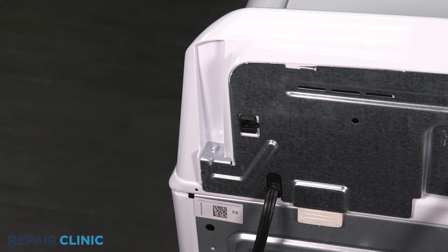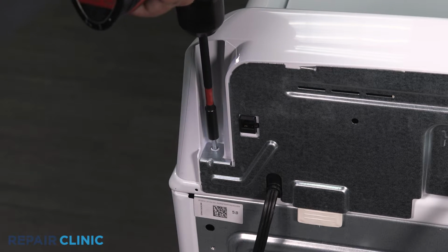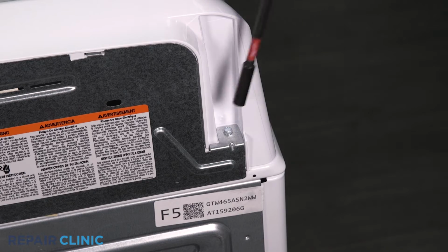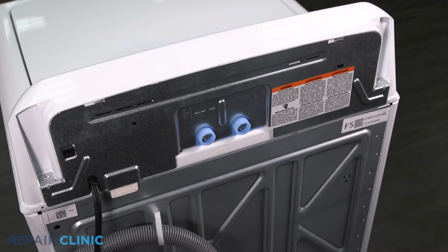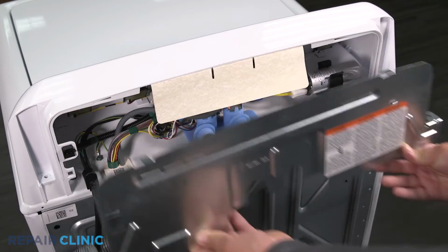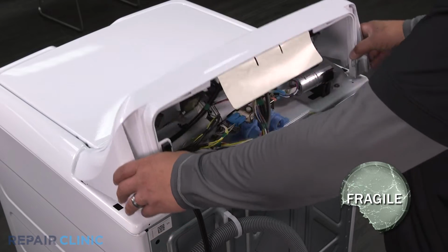Unthread the two screws on the panel. Any missing screws can be ordered through the links in the description below. Pull the panel out from the bottom and slide it to the right to free it from the backsplash. Slide the backsplash back and tilt forward.